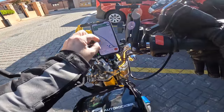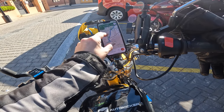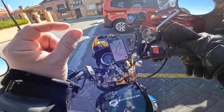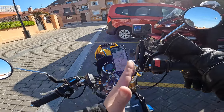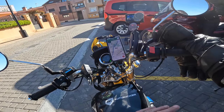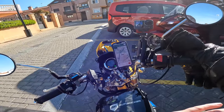Okay, so today's plan, we are here in Aro de la Encomienda, something like that, and we are just going straight there. We've been googling the problem with Ashworth, and it's a little piece on the chain tensioner that deteriorates. Why they'd put a plastic piece in the end of it is beyond me. It's to do with second gear, it's catching it, and worst case, it's going to cause the chain in the cam to come loose, slip a tooth, screw my engine.